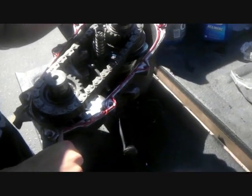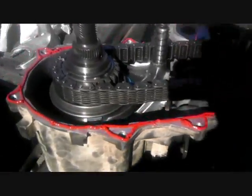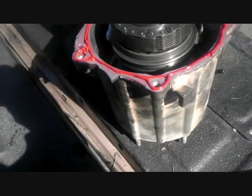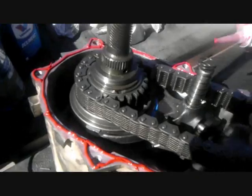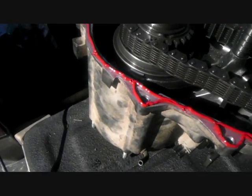So we're putting some gasket on right now just so that we seal it up again — it will be tight and it won't leak at all. The particular gasket we're using is this high temp red silicone, so it will work out well for the transfer case. You can see how thick we're putting it on, making sure it goes up and around each of the little bolt holes.